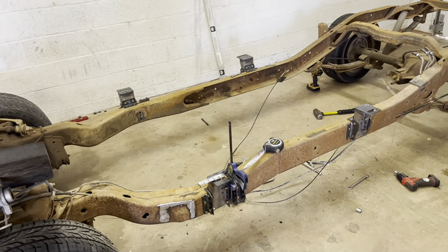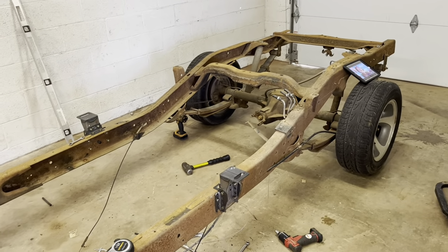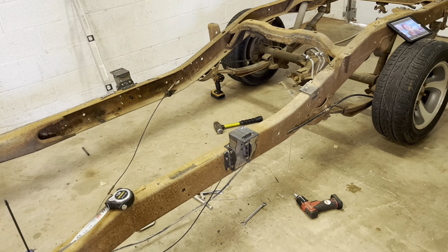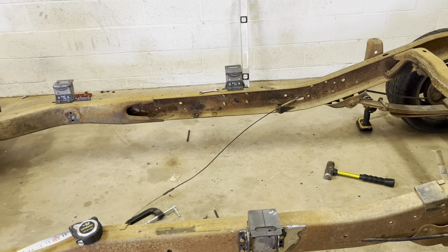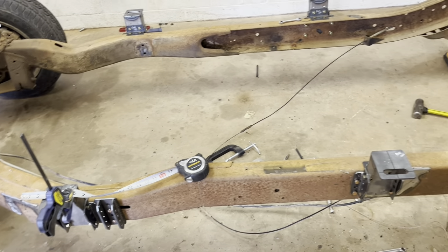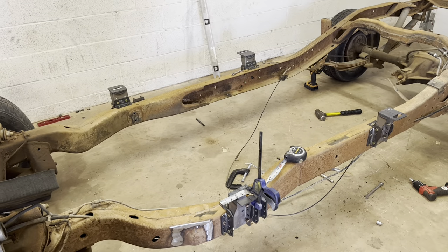So the cab mounts front and rear are done. Now all I've got left is to get the cab off the 54 frame, test fit it on here, and then we will start with the bed brackets. We'll take a measurement from the back one - center about 12 and a half inches I think is what the directions said, I'll have to double check - and then we'll bolt those to the frame as well. We might have to move our parking brake cables a little bit, but that's all it takes. Later on I'll show you what that bracket's for - you hang the running boards off of it. I'm going to end this video guys; if you like it give it a like, drop a comment and subscribe if you haven't already, and we'll catch you on the next one.